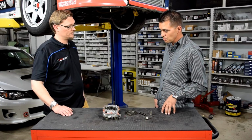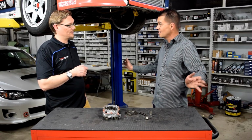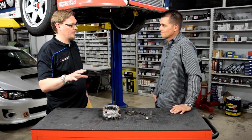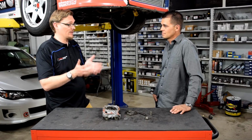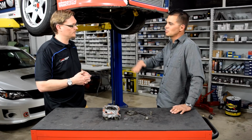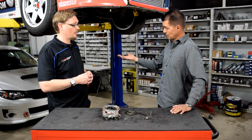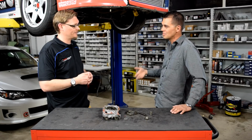And over time I've learned a lot between oil pressure and oil temperature. I know that they both go hand in hand, and I even determine my oil choices based off those gauges. It's not snake oil. If I get an oil that's a specific weight, I expect it to handle at a certain pressure and see certain temperatures. And because you changed the oil too, with the 12 millimeter pump, up to, was it a 20W-60? Correct. Yeah. So you went to an even thicker oil, because the oil viscosity itself will have an effect on pressure and possibly temperature depending on the type of oil that you're running. Exactly. And that was a great experiment too, just to see if there's any noticeable change. I also want to make sure that I don't have a mechanical problem. Sure. You could see oil pressure losses and perhaps there's a problem with the pickup. Right. So let's verify: if we still make changes and we see no change, then there's probably something else we need to be looking at.